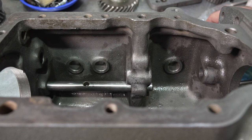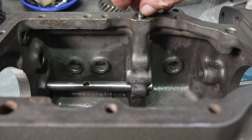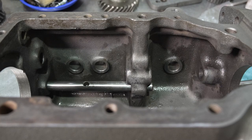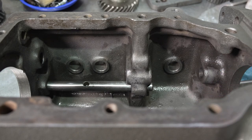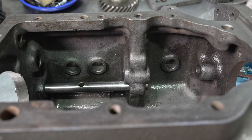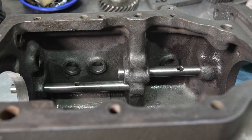I'm starting by putting the reverse rail in the case by itself, then I'm going to drop down what I think are the detents — the longer barrels — dropping them down through the holes from one to the other. On this rail I'm going to put in the pass-through pin and get that in place. I'll drop another interlock down and see how that feels.